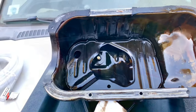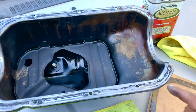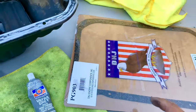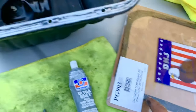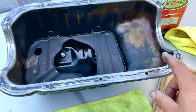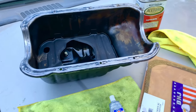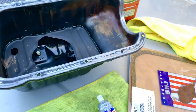Now that we've cleaned the engine block on the bottom, we clean the oil pan and put on the new gasket. We cleaned all the way around where the gasket will sit using acetone to get everything completely clean. The bolts are clean, and now we get the gasket out — make sure you have the right gasket. We can see the correct cuts on it, and we'll use Ultra Gray silicone here and there to help the gasket sit and stick so it doesn't move when we push the pan into the engine.